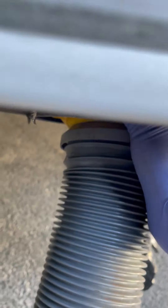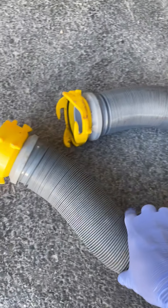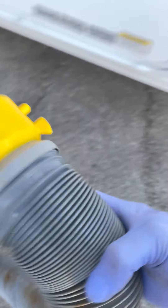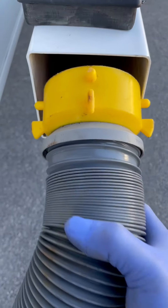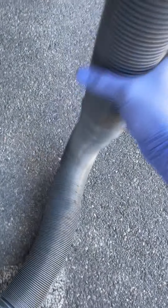After that, remove the hose connection by turning it to the left. Remove it and place the cap back by turning it to the right — make sure it's secure and tight. Then arrange the sewer hose and replace it back to the rear bumper, which is the storage for the sewer hose.